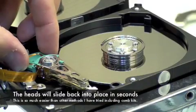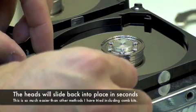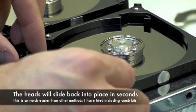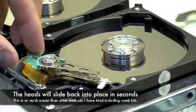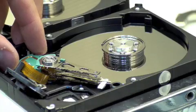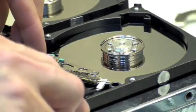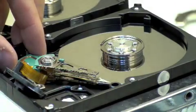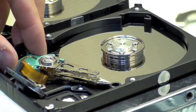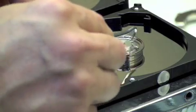And this can be made for a couple of nickels. Basically, I'm going to push from the back to push the head assembly up onto the platters. And I did not have to use any special tool to help pry them apart or do anything along those lines. All I want to do is physically pull out my tool from in between the platters as smoothly, as quickly as possible. And then I'm going to turn the platter itself in the direction that the heads are pointing so that I can move the head. You really need to make sure that you're moving your head while the platters physically are turning.